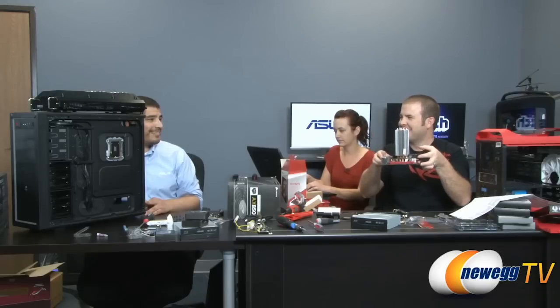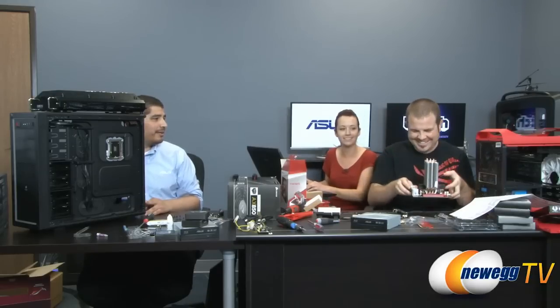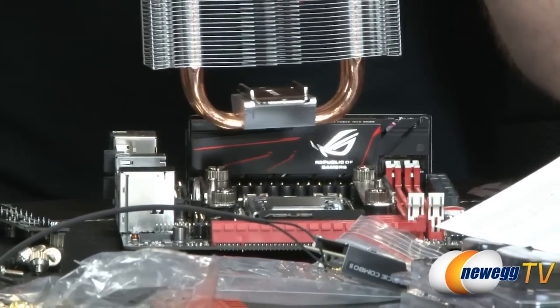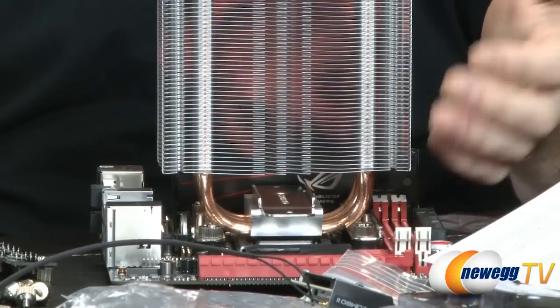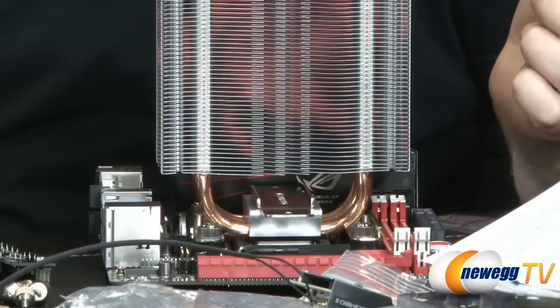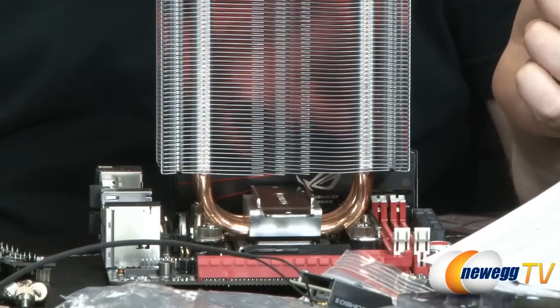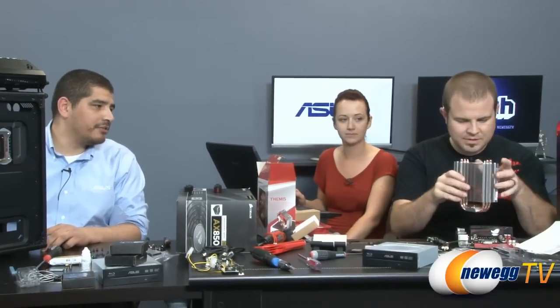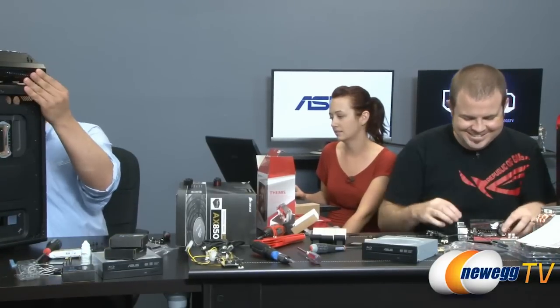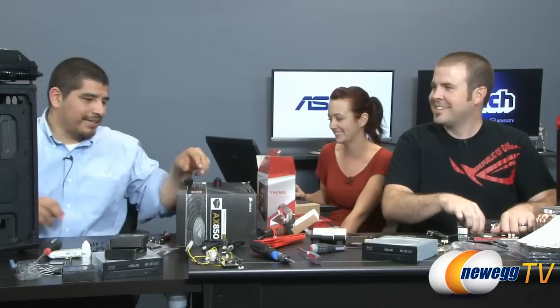I think we might have a compatibility issue here. In terms of what? This heatsink is conflicting with the daughter board here. Oh, in terms of the clearance. I could rotate it 90 degrees, but then it would conflict with the memory. So I can use this cooler and go with some lower profile memory, or I could grab a different cooling unit that we might have on hand. Let's just go with something basic. It's a shame, but you could just throw a retail cooler on there for the interim if you want to catch up with me as I'm kind of beating you. JJ's like done. But entirely up to you, boss.